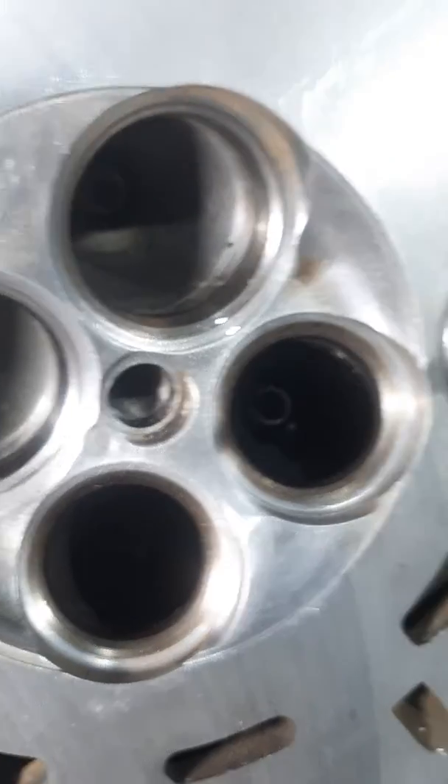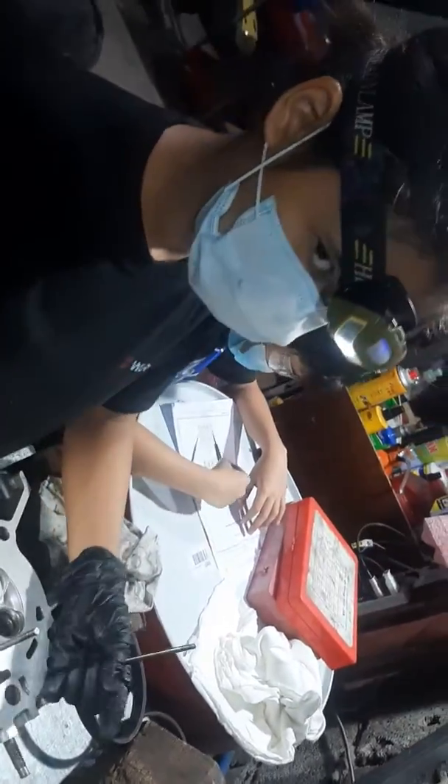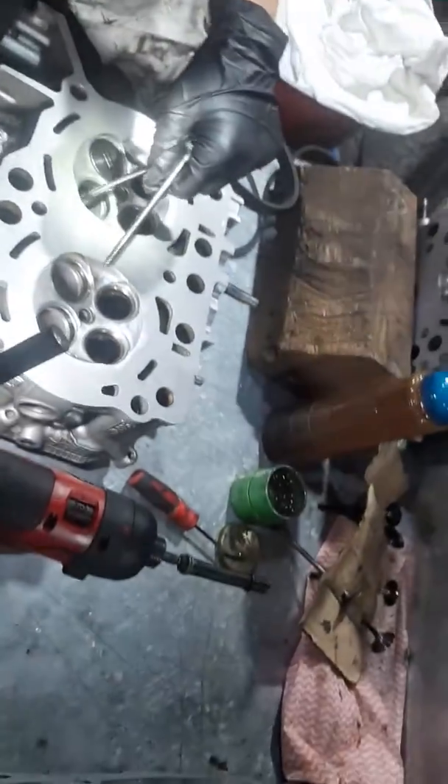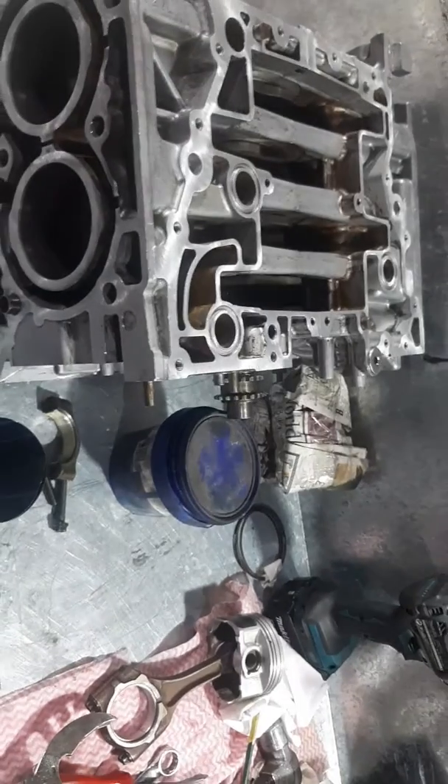She just has to go through a bit more lapping on the rest of the valves, and that should be all right. On my part, I'm just going to try to fit in tonight the last piston on this one and go from there.